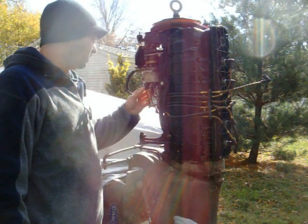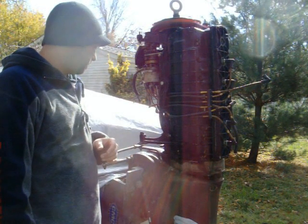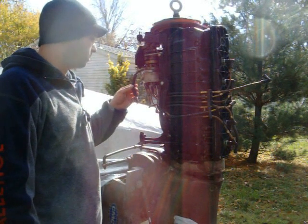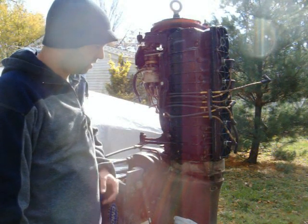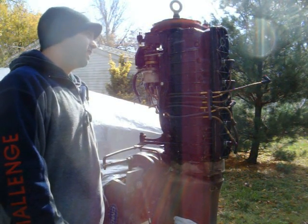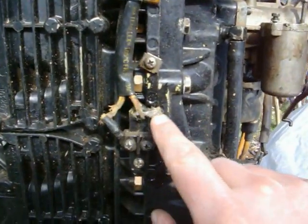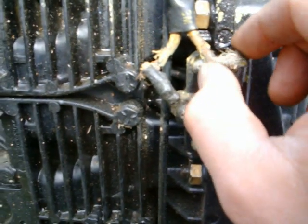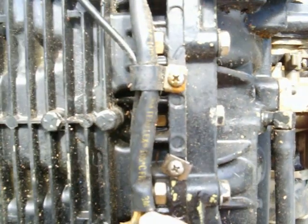I really don't know this one's condition, but I took the cap off and it looked like hell inside there — there's a ton of grease on it, somebody's been pumping it full of grease like crazy. So I'm going to begin to disassemble this. After I get it disassembled, I'm going to start taking apart things on the sides and putting new gaskets on. I'm also going to address these connection ends. I'll take a wild guess that this stator is in better shape than mine, but as you can see, common on these Mercuries, these things rot out. I fixed the ones on my other motor, but these wires look like they're in better shape right now, all the way up to that important connection. Mine were broken up there and I had to re-solder all this together and use electrical tape.